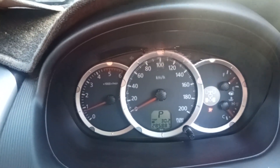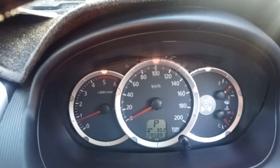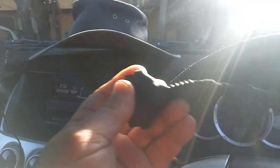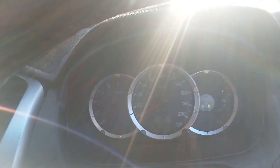Here's an example of a Triton — I blocked the EGR valve on this. Notice there's no check engine light. If I had done this to a Pajero, there'll be a check engine light. Here I am on a Triton, I've blocked the EGR valve right, and the light is not on.